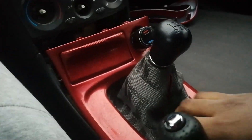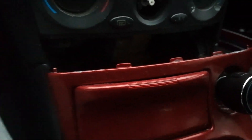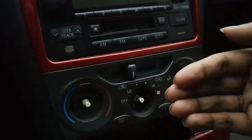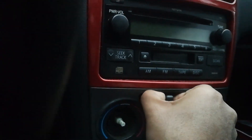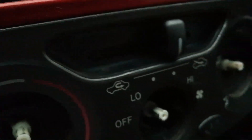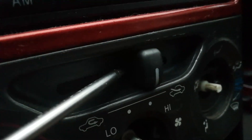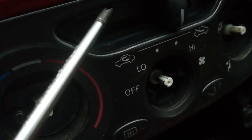To start, you pull out this bit — put your fingers in here and pull up on both sides and pull it away from the dash. You take off these screws, they pop off, and this pops off as well. I found out that it's very helpful if you put a screwdriver in here and push up — that can get the switch to unclip. You don't want to put the screwdriver against the trim or you might scratch it up.